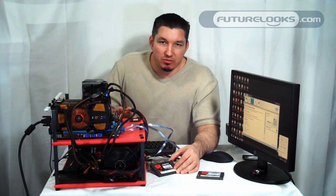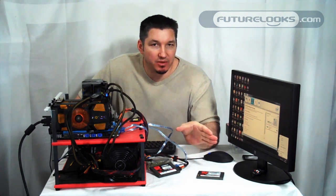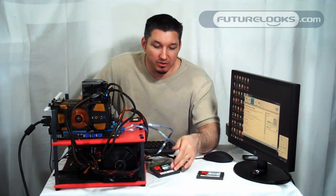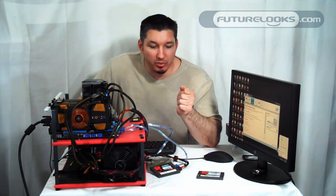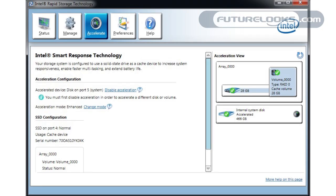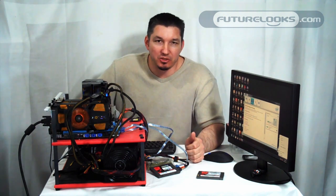You just run that and it resets the registry options for you. Then you reboot the system, go back into the BIOS, select RAID, save and restart. When you come back into Windows, you shouldn't blue screen. We tried it out on two different drives — both 64 and 30 gigabyte — with a fresh install of Windows that was not configured for RAID, and it worked both times. When you reinstall your Rapid Storage Technology software, you should see the accelerate button and then set it up from there. That will save you a whole lot of time if you're one of those who forgot you could use an SSD for caching to improve performance.